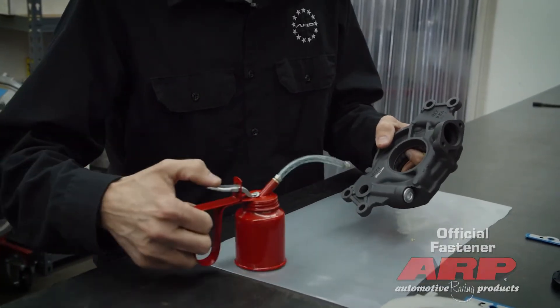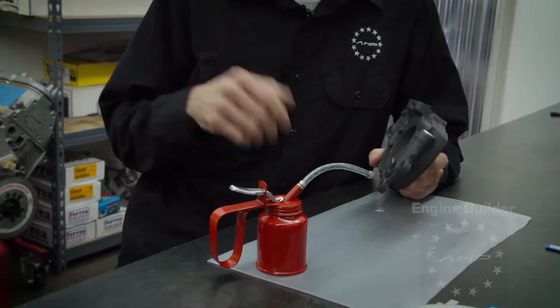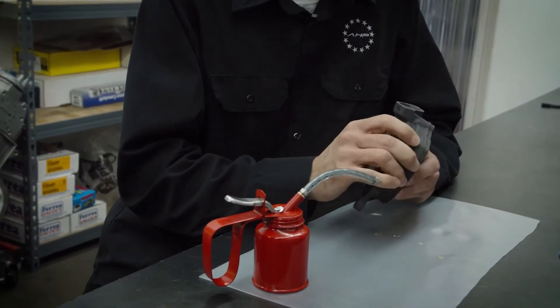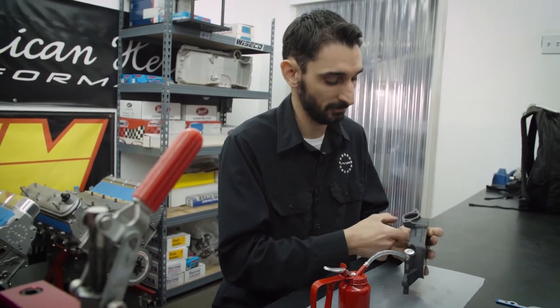Now eventually you want to get this as full as you can, especially if you're going to be priming the engine with it in the car. You don't have a great option of really priming it ahead of time, so you want to have as much oil in the pump before anything happens. Getting all the oil in here now is very beneficial. See, I lost that sound now — now it's just oil.